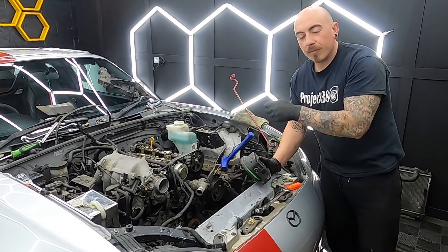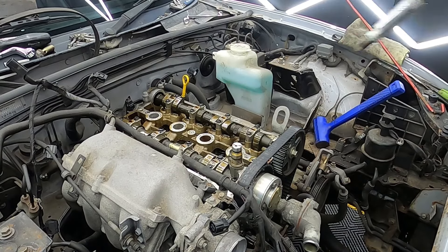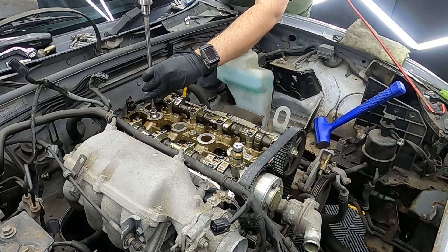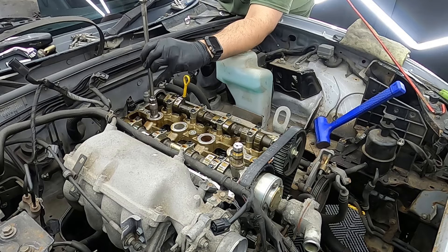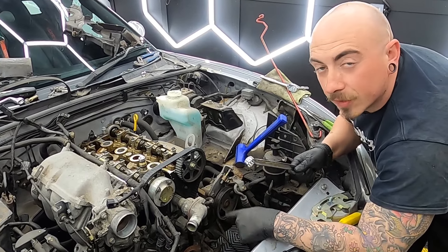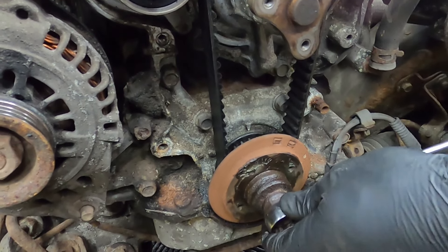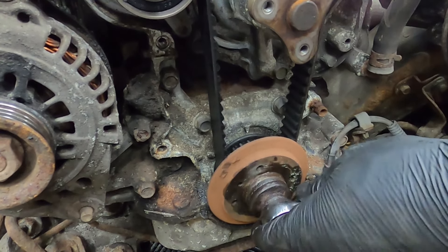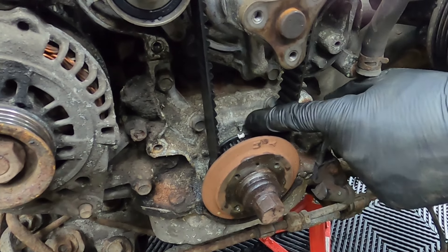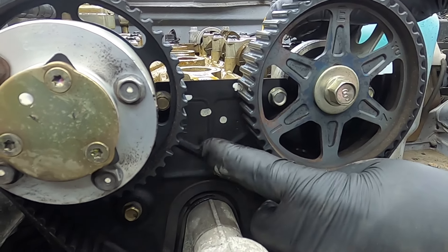But before doing that we want to make sure the engine is in top dead centre, and to do that we now need to align the marks. Down here on the bottom crank pulley is a mark right there, and up on the cam pulleys we need to align the marks on the cam with the marks on the timing plate. To make it easier to do that we're going to remove the spark plugs so there's no compression in the engine — we can rotate the engine with ease and get it to where we need it. With the spark plugs out the engine is now free to turn, and that's why we've put the bottom crank bolt back in, so we can put a spanner on the bottom and align the timing marks.